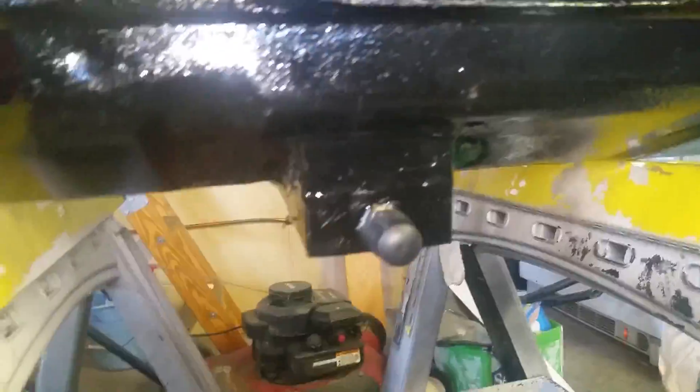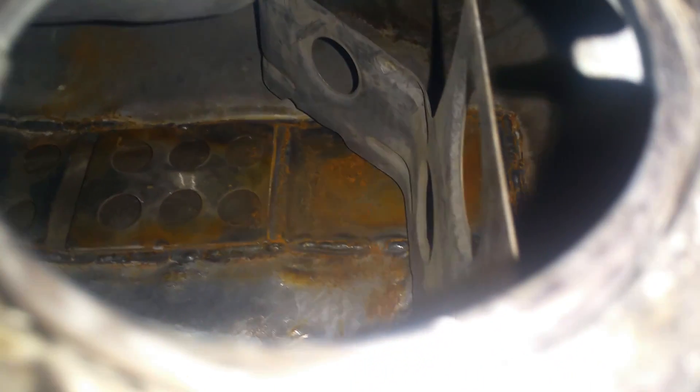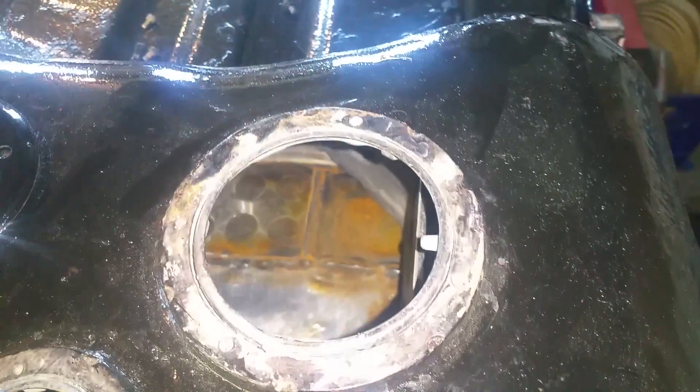Went ahead and sumped the factory tank, so it came out all right. A little issue I'm having right now is it's starting to get a little bit of surface rust on the inside. Smart thing to do — I'm gonna dump some vinegar in it, let it eat all that rust up, neutralize it with some baking soda, then throw a tank liner in it and that should be good to go.